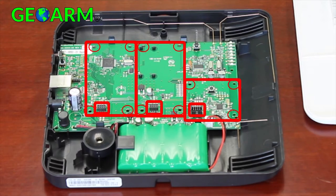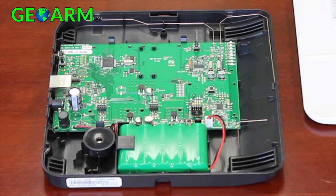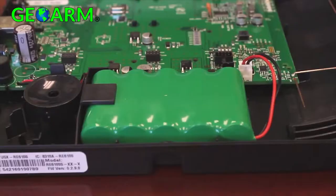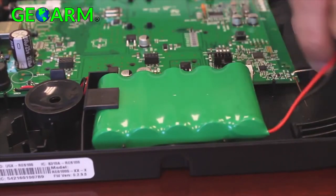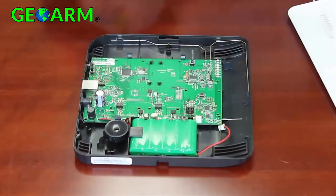The connectors highlighted are where the pins or receptacle on the expansion card interfaces with the main board. There are also three or four holes on each card, allowing for mounting pegs to be attached. Be sure to remove the backup battery prior to installing any expansion cards.